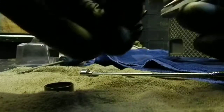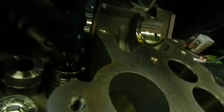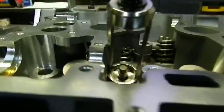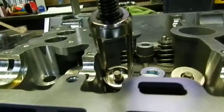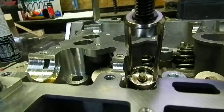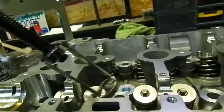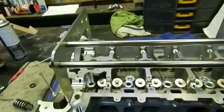Pick up the second one. It does actually make it a little easier for these to slide onto the valve stem slots if there's a little bit of oil on them as well. There we go — that's how easy they are supposed to go on. Once the keepers are in place, you carefully raise the spring, keeping an eye on the keepers making sure they don't jump. Do it slowly, otherwise you'll end up throwing a keeper across the other side of the garage. Then remove the tool like so.